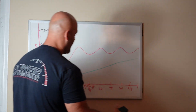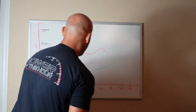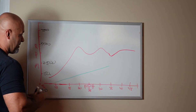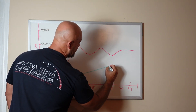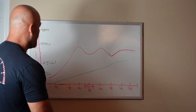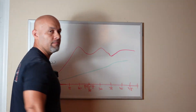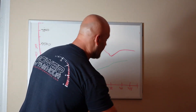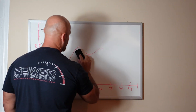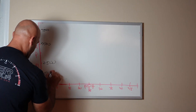So what happens when you do lock a converter? Let's say right here you lock the converter and you have that noticeable dip that we see on the data log. What happens to the mile an hour graph, believe it or not, is it slightly goes up - a very slight raise in the data log. And again, this is my observation, this is not scientific at all. So you see the 1→2, 2→3 lock up - it transferred more torque and mile an hour goes up, as opposed to that steady slow climb you were seeing when the converter wasn't coupled.